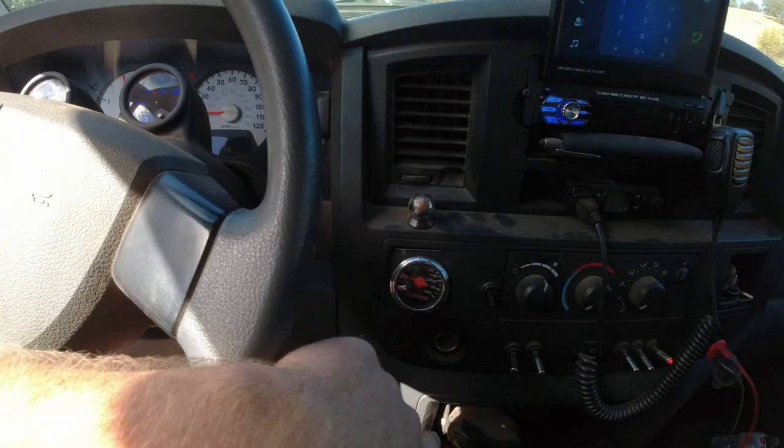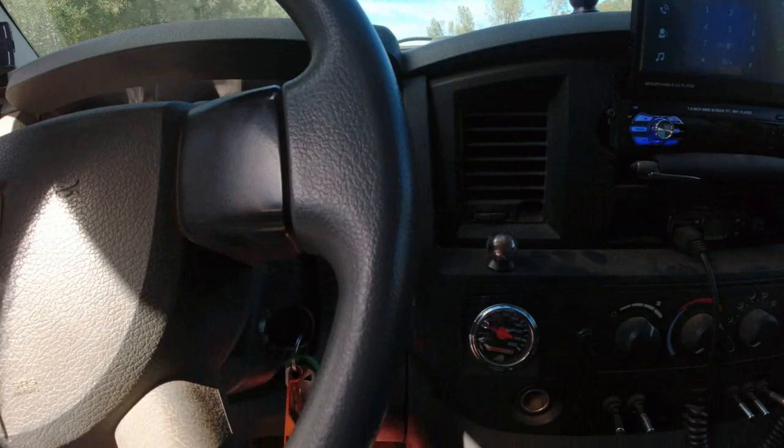I guess if you're going to test her out on the first run, test her out. The tires are actually slightly squatted, so the truck is actually holding quite a bit. I'm going to put some air in the bags. Kind of bummed that that thing's leaking. I'm going to get a different coupler. There's a little coupler between the gauge and the hose, one of those click connectors, and I've had that brand leak before, so that's what's going on right now. But it feels good. I like it.